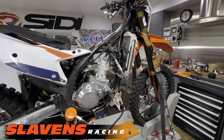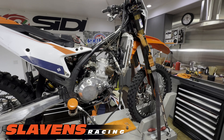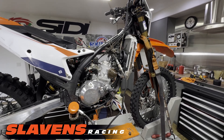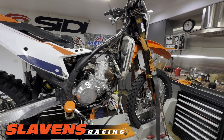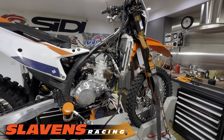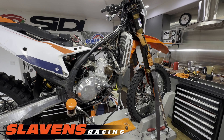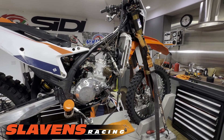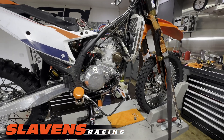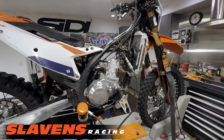Now just to make clear, this video is for two-strokes only. Any of the modern four-strokes, in the last 10 years or more, they all have a decompression device on the camshaft. It holds the valve partially open to lower the compression slightly to make it easier for the electric starter to start the motor. On those models you cannot do an actual compression test — you have to do what's called a leak-down test. Totally different process. Looks kind of similar as far as gauges and stuff, but it's not. This only applies to the two-strokes.